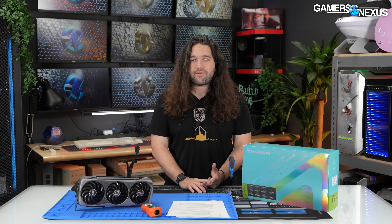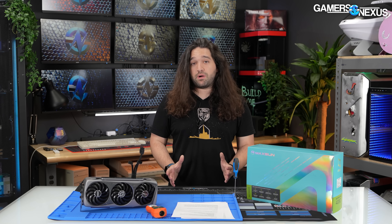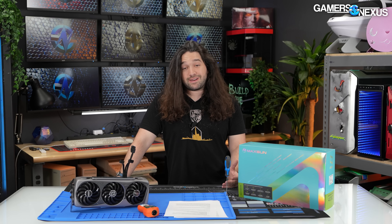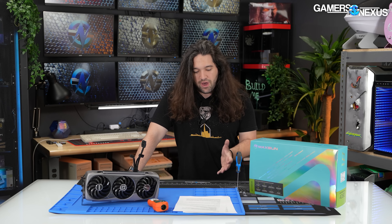There's about 30 degrees of headroom on the memory for the Mega Gamer card, so that's in a good spot. The delta from the hot spot to the GPU core average is only 10 degrees Celsius, which is about what we'd expect for a reasonably designed card — alarm bells only ring when you're at 20 degrees-plus, which you see more on something like an XTX. At least that much is objectively fine. It's just that the FE card is doing better. So that's thermals done — on to noise testing.